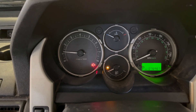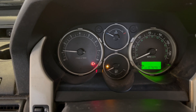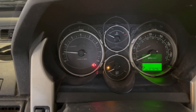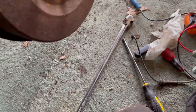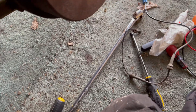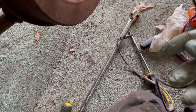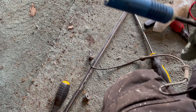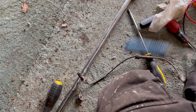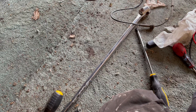So that's how to fix your three amigos. Very often it is an ABS sensor - probably 99% of the time it's one of those. You can get rust on the hub which misaligns them, which may have been the case with the old one, but for 20 quid it was easier just to change the sensor. I don't believe measuring the resistance of these is a valid test because these are Hall effect sensors - electronic devices which don't really register very much resistance on a multimeter. You really do need a scanner to check which one has failed. Thanks for watching, good luck with yours.